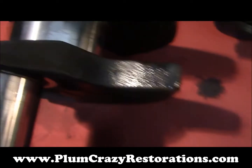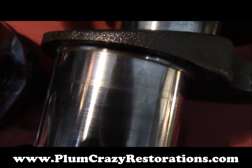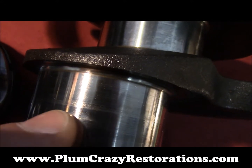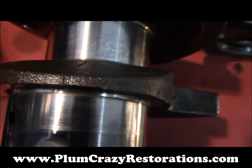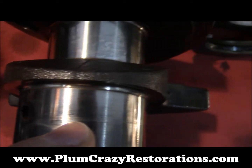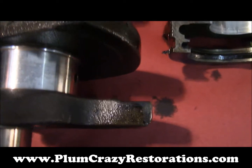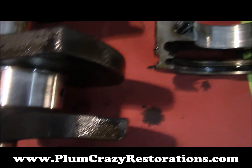Which brings me over to the crankshaft. If you look at this lobe here, you can see this wear mark. Obviously something's gone through the motor — excessive wear — because this is where the oil comes out and that's where the wear starts. So the crankshaft should be checked out and turned, and if it's salvageable we'll reuse it.